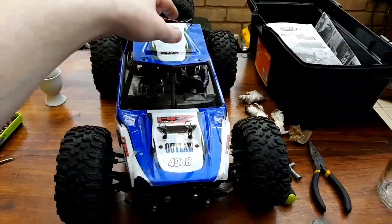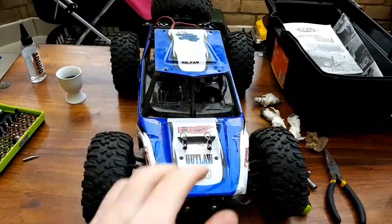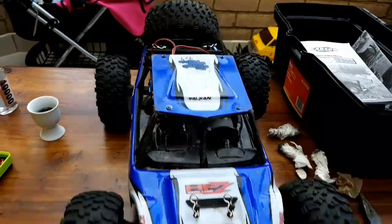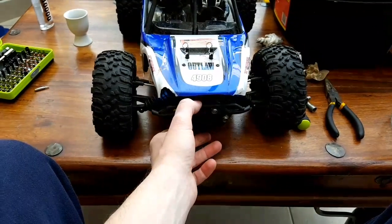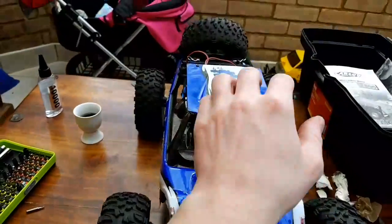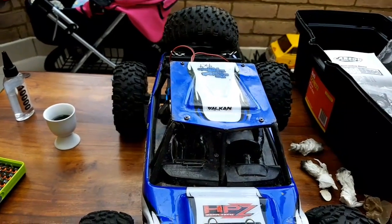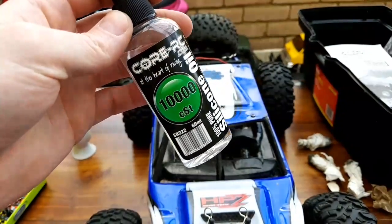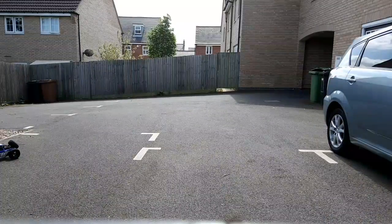You can see the difference straight away — if I press the car down, it is rising up much slower than it used to be. I'm not sure if that's not going to be too stiff to be honest, but we'll find out. And if it's too firm, I'm just going to change the oil again, maybe for 5,000 CST this time instead of 10,000 — half the density. We'll see how it drives first. Let's give it a try.